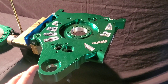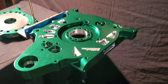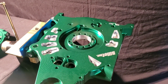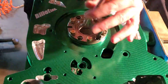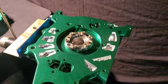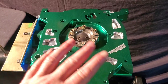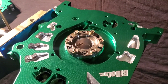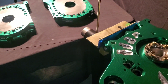With the front plate assembled, inserts in, Hylamar applied, and torqued down, the stationary gear is dropped in. Chilling the stationary gear is not strictly necessary, but it helps ensure a great drop-in fitment before torquing it down. The front stationary gear went in really nicely. All hardware is Loctited down. It's then a great time to assemble the rear gear to the rear plate as well, so that all side plates are fully assembled and finished.